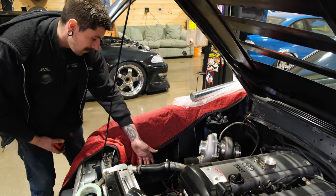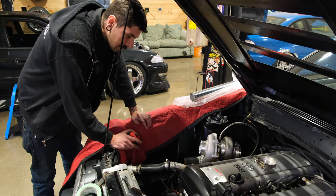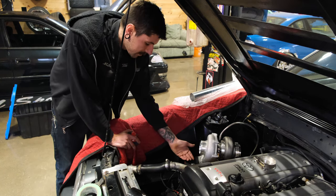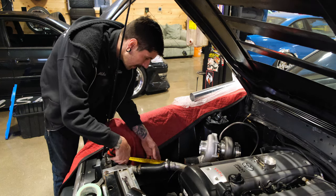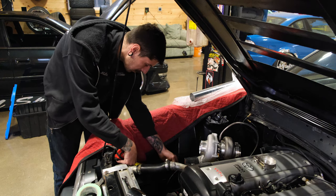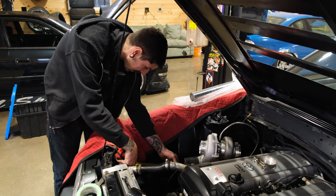But yeah, obviously there's a little bit of an angle. We could cut an angle into the pipe to make it line up with it, but I honestly think I can loosen these nuts, sneak it over just a little bit more, and we should be fine to just rock a straight section. So again, go back in. I have this one pushed in the coupler as much as I want. We don't want blowing off couplers. And we are pretty much dead on 15 inch at the housing.